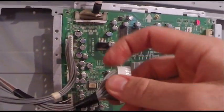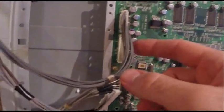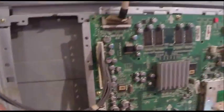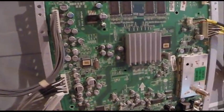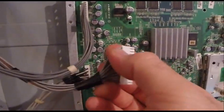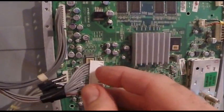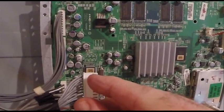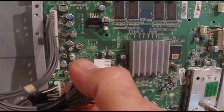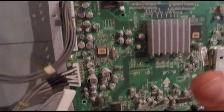It was this very top one up here. When I would just barely touch it, it would blank out, and you could hear it as I was wiggling. You could hear it losing connection. So it was this top one right here, and to make the contact better, there's a little clip in here that you push in, and you'll be able to pull the pin straight out the back.